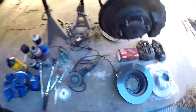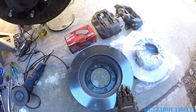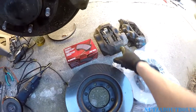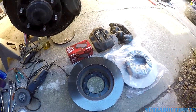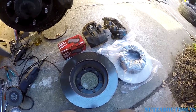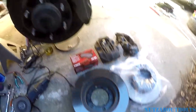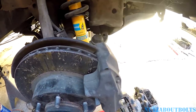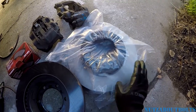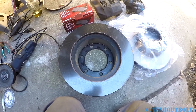Much better. So what we are doing is we're taking the old rotors out, taking the old calipers out and making some slight adjustments and modifications, which means trimming the shield right here. And then we're going to be able to put in our thicker rotor. It's actually the same diameter — I think it's 319 millimeters.